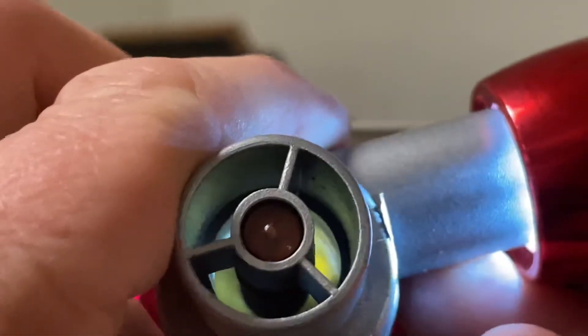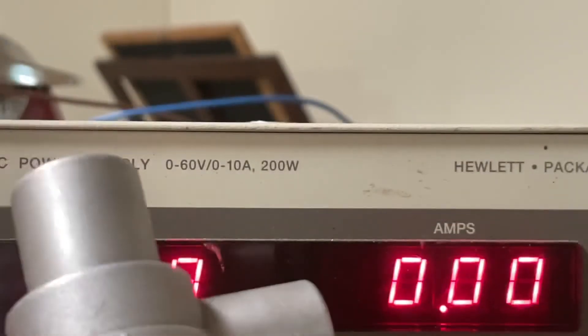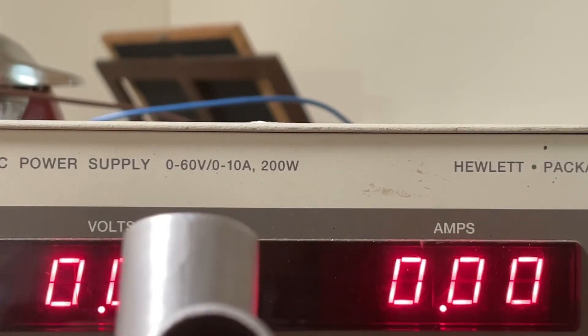Both of them — we have to pull the plug out and adjust them so that the plate closes at 1 amp. It is of course easier when you have a power supply and you do it like this with the light, then you pull it out and adjust it. I don't want to do it right now as I don't have the right tool to pull it out. But maybe I'll do another video and show you on this unit — then it will idle at 650 to 750 RPM with the control unit I have.